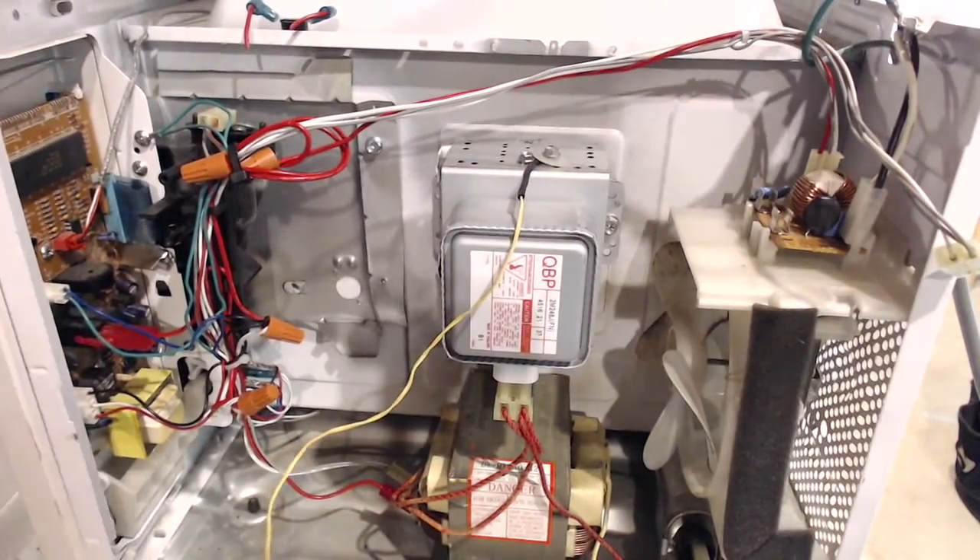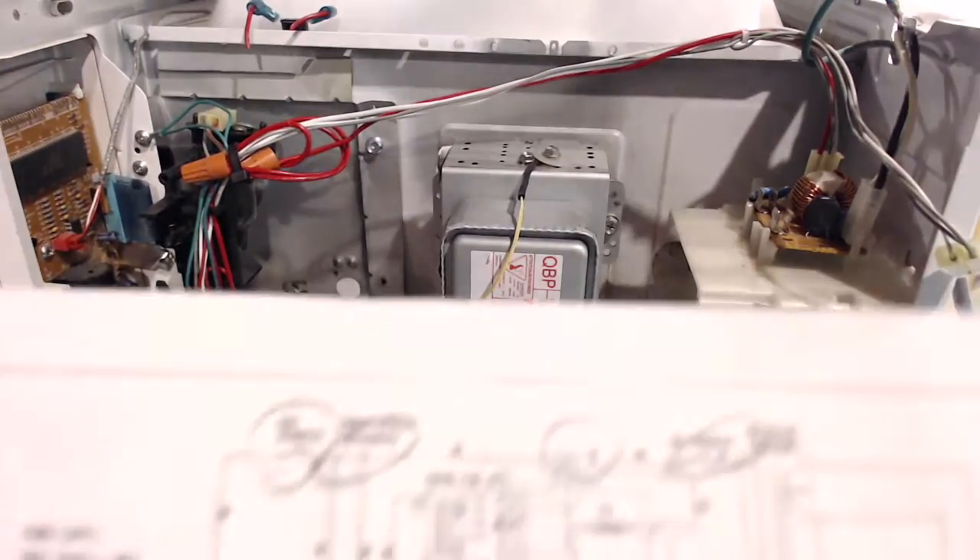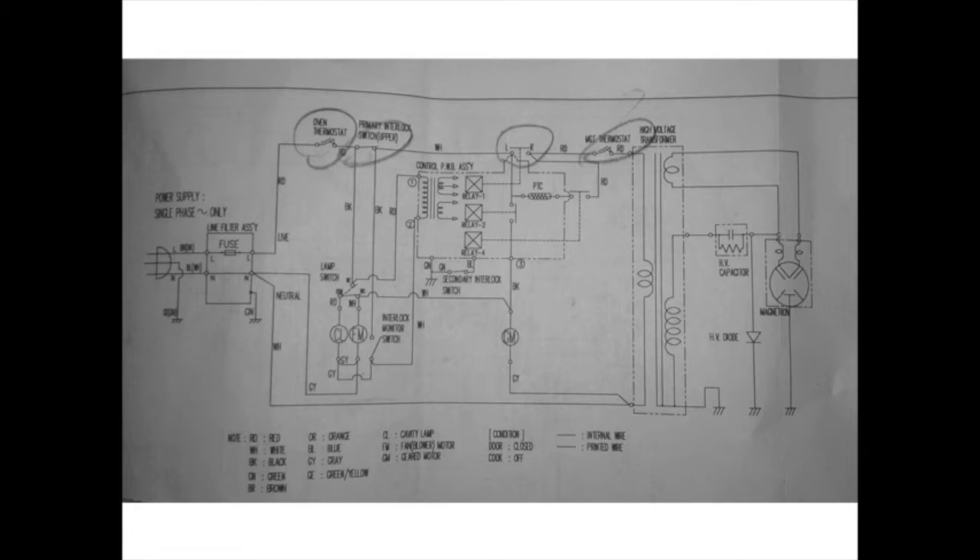You can see a lot of wire nuts, and the reason I did that was to bypass the microswitches and the main relay, the mag TCO, and the cavity TCO. I also bypassed the fuse because it was not there.